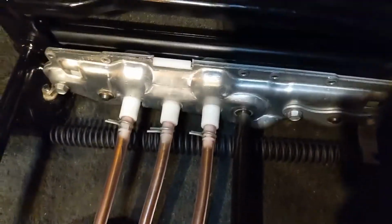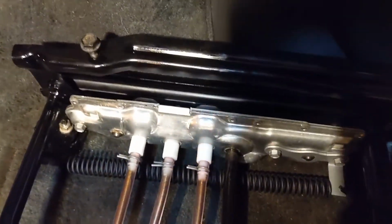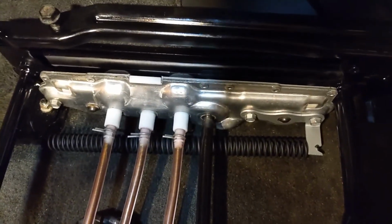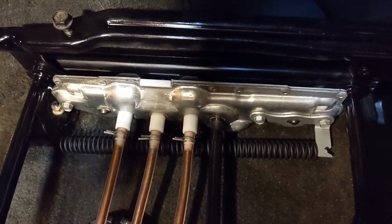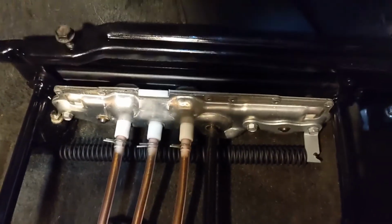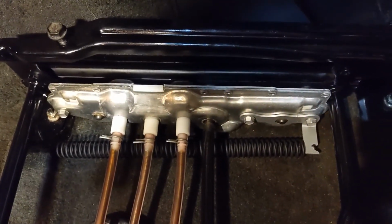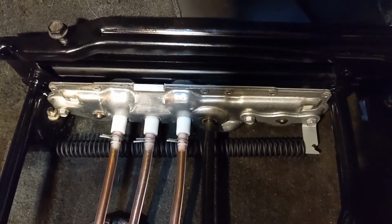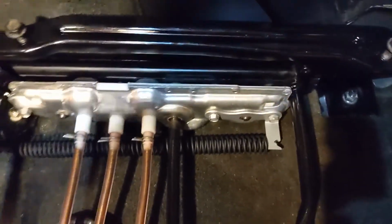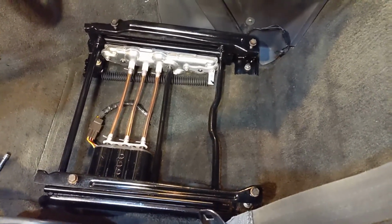Of course, the only thing that really goes wrong with it is the transmission and those gears. These things all break apart because it's kind of one solid plastic unit. I saw some guy repairing it, but you can't get these bushings. So unless you know how to CNC stuff or whatever, you're not going to be able to rebuild this on your own. So this is remanufactured. I believe it was a guy named F Parts on eBay, and it was like $220, $230, something like that, which is the same cost as everybody else, but no core. So I'm going to keep my core and maybe one day rebuild it and put it on the passenger side. But there you go. Now I've got to put the shell on and put the cushions in.